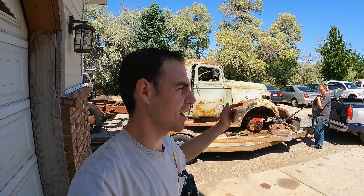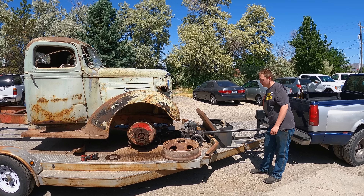Kenner and I are out here today. We got this '37 we got a while back, and it's been on the trailer ever since we got it home. We haven't had a place to put it. Well, we finally have made a spot for it, and we got to throw these wheels that came with it on there so it'll at least keep stuff out of the dirt. We pulled the lug nuts off, ran a tap and die, threw everything to clean all the threads up, so hopefully we can bolt these on.